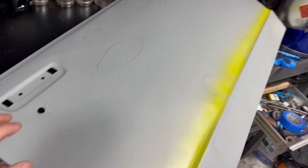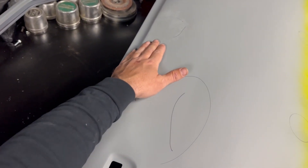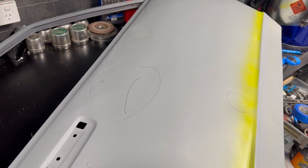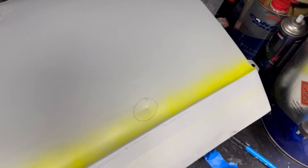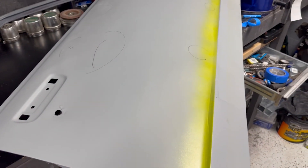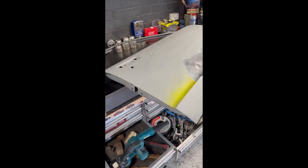I've started at the top and I've been using permanent marker to circle any obvious low spots. This area through here is a lot better now — a little bit bumpy but nothing on what it was before. There's obviously still a ton of work to be done. I created a straight edge with masking tape and put some paint there so I know where to work to when I'm hammering this all out, because it's pretty wavy. Now I've got a nice straight line — if I can form it to where the yellow is the whole way across, I know once it's on the car it's going to look a lot nicer.